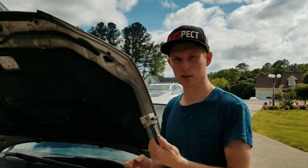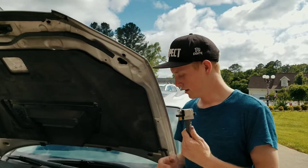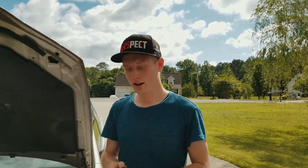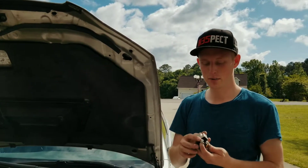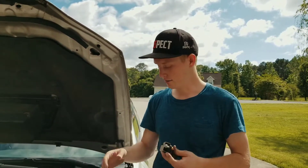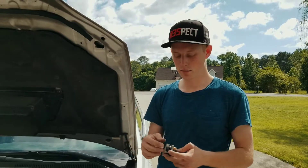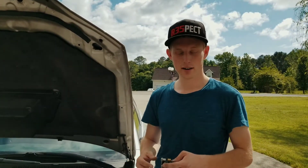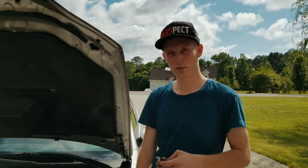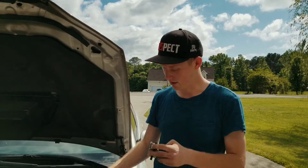Today we are going to be replacing the coil pack. This is actually the old one — I already jumped ahead and did it, but I realized I didn't film it, so I'm going to throw in a clip of me redoing it. It's really simple. This one here is a 12 millimeter bolt. My car's throwing a code saying cylinder bank 2 is misfiring, so I looked up on Google which cylinder was number two, and it's the front right one when you're looking at the engine bay.